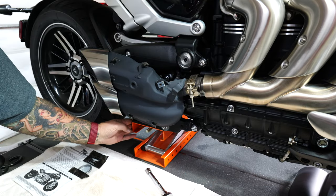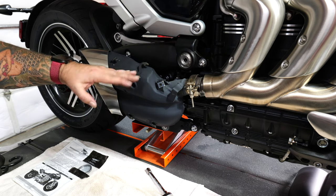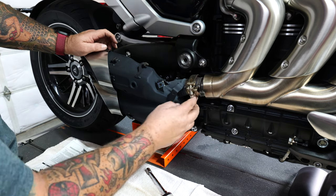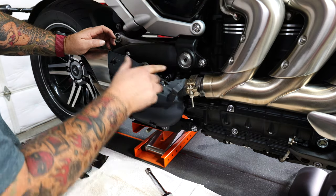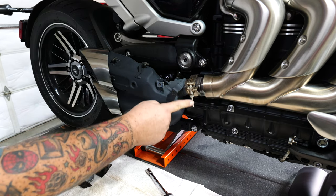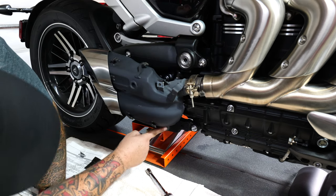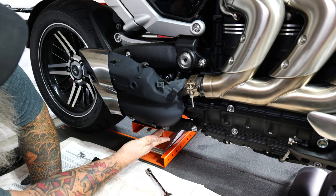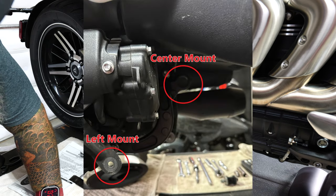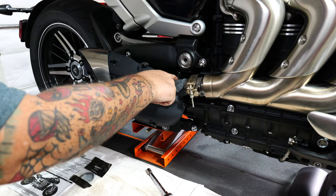What you may have noticed is I have a jack stand underneath — a table jack — that I've got because I want to hold the weight of the exhaust, because this thing weighs about 30 pounds. So once we drop everything down, I don't want to have to fight that and hold on to it. So you have your attachment here, which is your clamp. Once you pull out that second shield guard for your foot, you can see you've got the nut plate we pulled out, a 10 millimeter clamp bolt, your O2 sensor, another bolt that mounts the converter, and then on the other side as well as a bolt in the center.